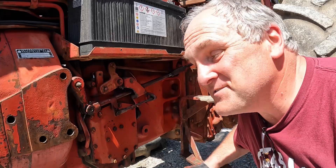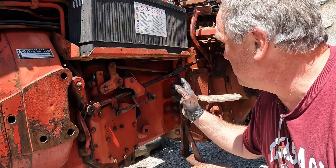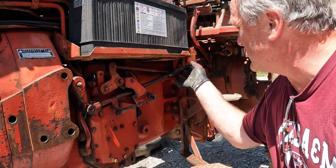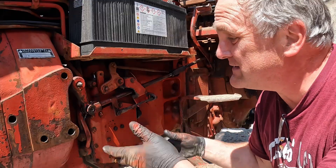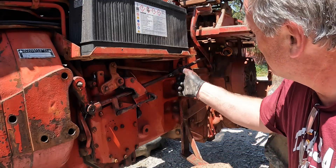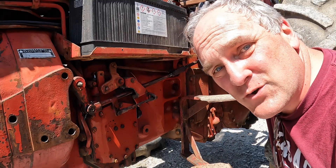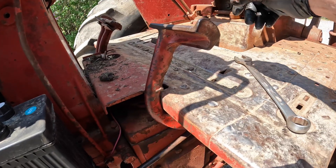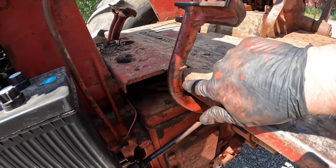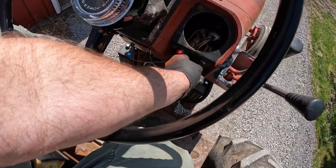There was a little passage of time here. This clutch rod was all bent up and the turnbuckle had been screwed up by somebody getting in here before me — the threads didn't match on either end so you couldn't really adjust. I had to take it all apart, clean it all up, chase the threads, grease it, and now I've got the clutch adjusted properly. I also used the manual recommendation of 11/16 inch free play — the distance from the pedal to the platform — to adjust the clutch linkage.